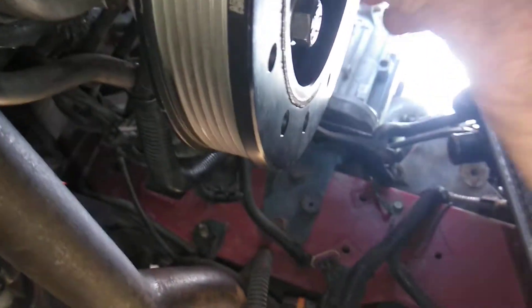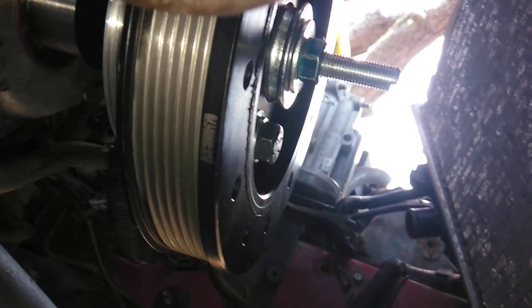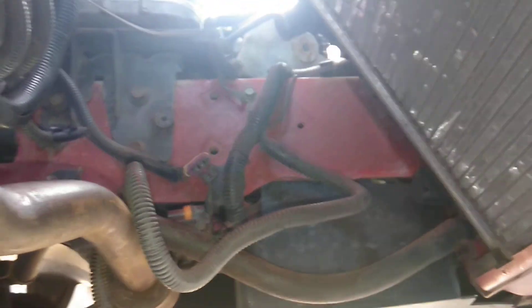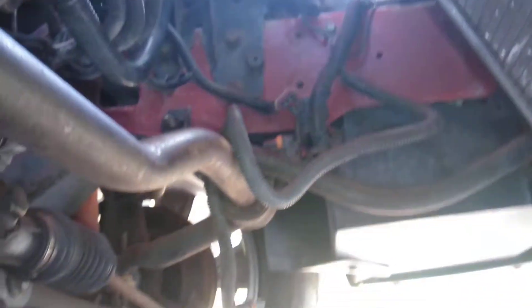You keep on pressing with this. The reason why you don't use the factory screw to drive it in is because it'll pull the crank threads out - you don't want that. This is a tool you have to use; you can also use an impact, but I'm taking my time and pulling it in so I can watch everything. Afterwards the underdrive pulley is going to line up with the rest of the main accessory pulleys, and there should be about a fingertip gap - maybe that much - between the OptiSpark and the underdrive pulley, if you can see my finger up here.